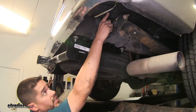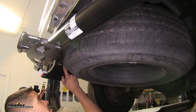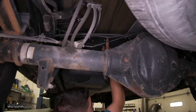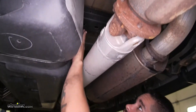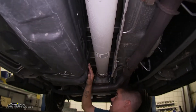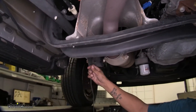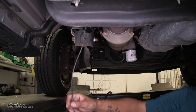My charge wire came down right here and I zip-tied it to my four-pole wire, running it across to the driver's side. I actually ran it over my spare tire cover, went over this crossmember, and then came down right by the fuel tank, putting it behind this cover underneath and following it down. I zip-tied it to some fuel lines here, went behind the heat shield, and right now I just have it sitting here. We need to move up to the top and I'll show you how we're going to get our wire up to our battery.